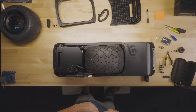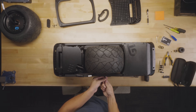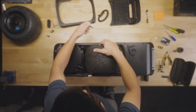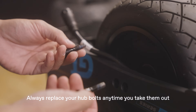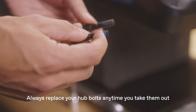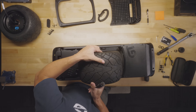Grab your TP-45 and loosen up these bolts. Go ahead and take the head off and work them out — you can keep using the torque wrench or switch to the electric driver; it's a little bit faster. Even on a brand new board, just the act of putting the bolt in and taking it out means the paste is dispersing through the thread, so we'll go ahead and apply fresh paste for an even distribution. Then pull the motor out — as you pull it up, make sure the cable is clear. Pull it straight up and the axle block will likely fall out.